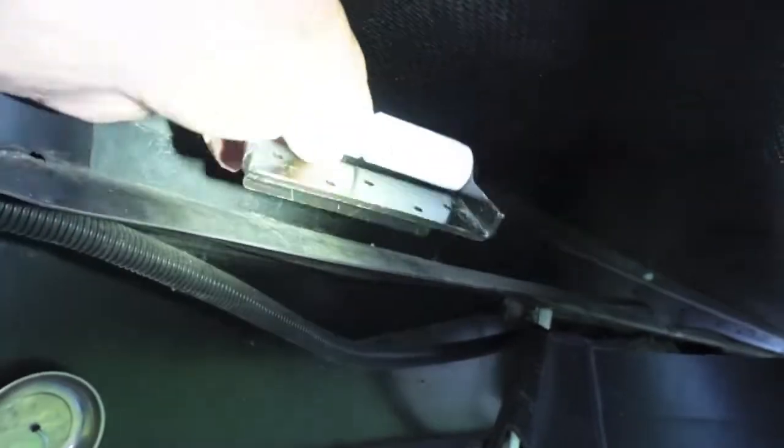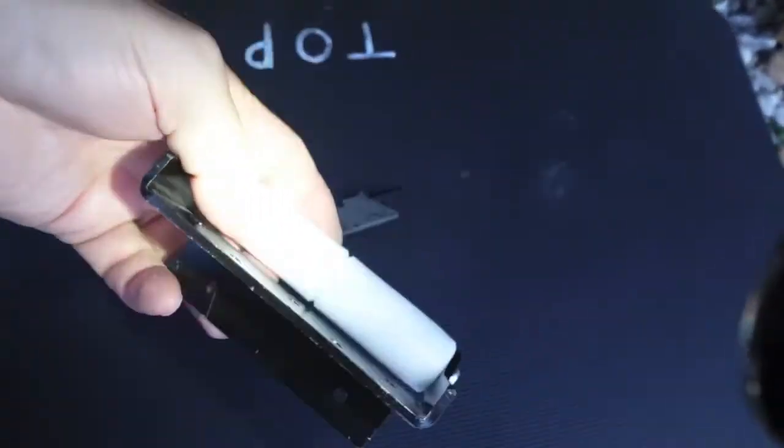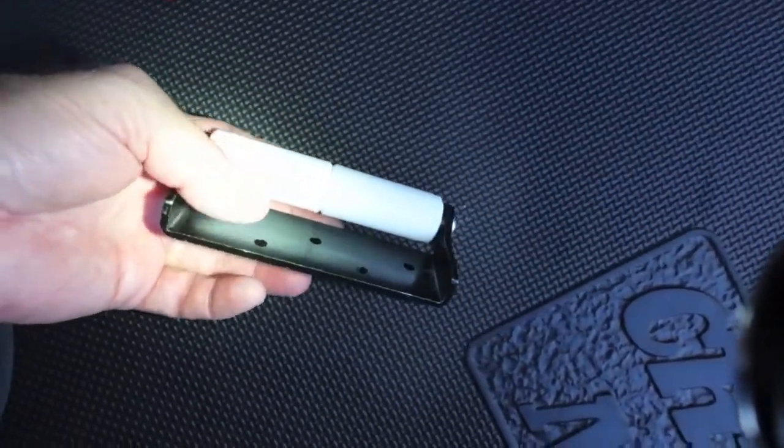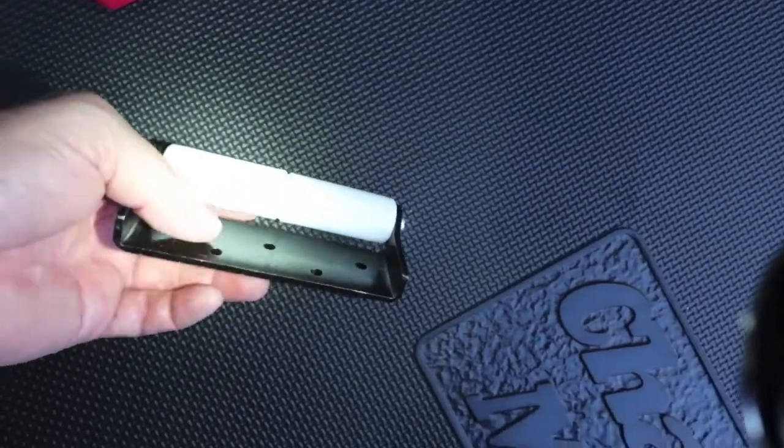And when I get that brought up like that, I'm going to do something to fill in these gaps the best I can. Because you have a gap on the back side, although it's not very much. You can see my finger there. That's the gap on the back side. So any insects and cold will be able to come up through that crack and migrate its way right into your living room. But it's a huge improvement.